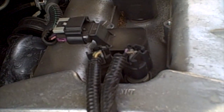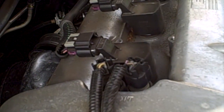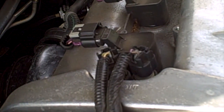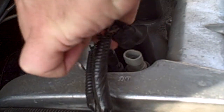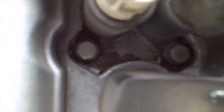We are going to do one of these at a time so that we don't confuse them. The solenoids are actually both different — they are keyed differently on the top connectors and they are color coded as well once you pull the connectors off. These electrical connections simply pull off by squeezing and removing. To get these solenoids out, they are actually held in with one little bolt.